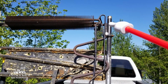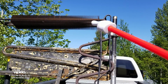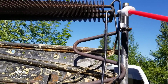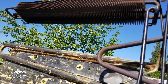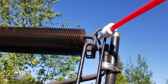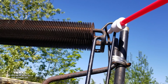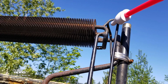Okay, so at this point, we're going to stop the trail of ammonia. Again, the first time we stopped the trail of ammonia right before it was a vapor, then we went to this condenser. The purpose of this condenser is to get the ammonia to condense back down to a liquid. So let's pause on the trail of ammonia right at this point, where the ammonia comes into that small tube. And now what I want to do is talk about the hydrogen, because this strong ammonia liquid is going to be joined by hydrogen at this point. So let me bring hydrogen into the loop.